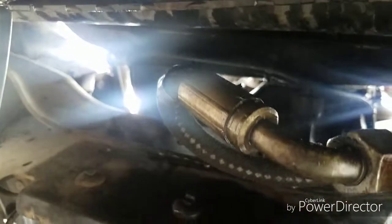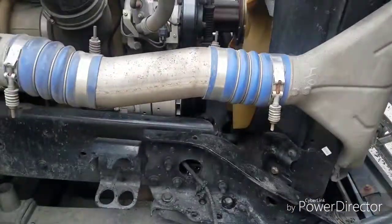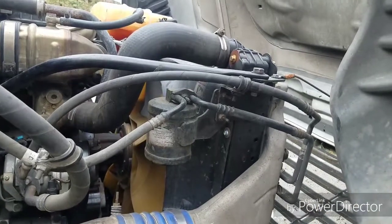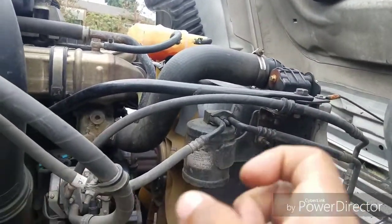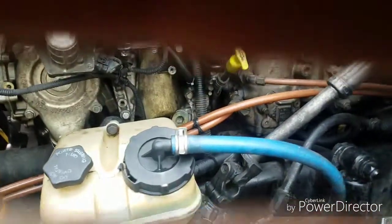The oil comes in here and then goes back on that hose, and I put a heater hose here back to here, so if there is water coming out it just loops around. This is just so you can make it to the shop. Some drivers are going to say the transmission fluid is going a bit hot, but you can make it — I did it and ran for 500 miles. After you do that, flush the cooling system and put clean water — like drinking water — two times so the oil runs out.